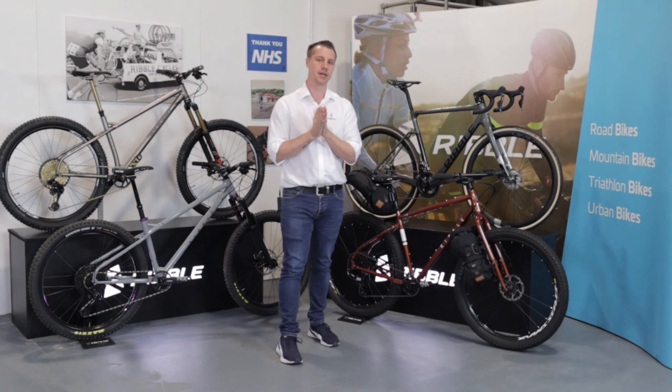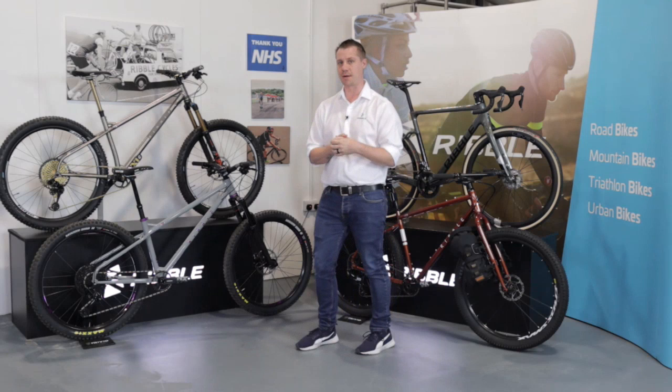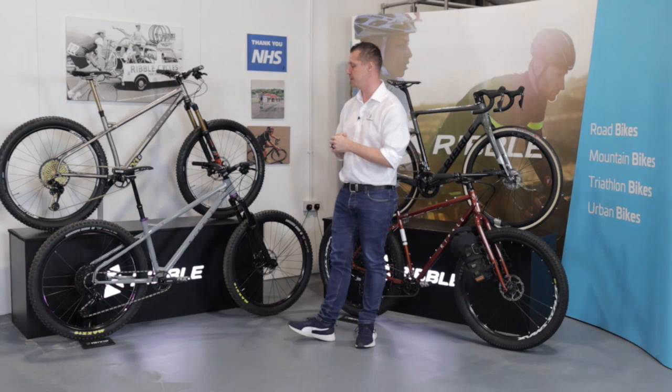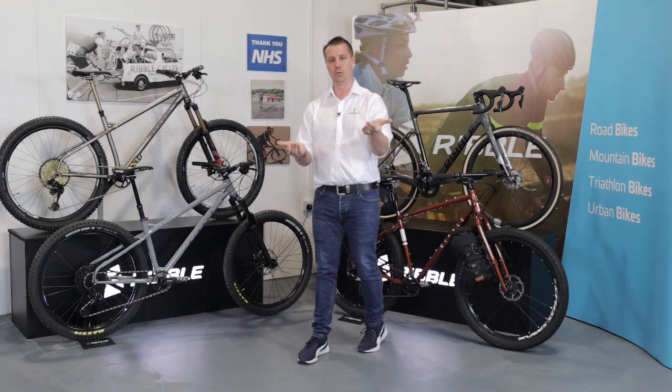And that's pretty much it for the questions now. Yes, outstanding. Nothing on the mountain bikes any further. We could cover them a little bit more. You will see through the bike building process that we have tire selection choices there, up to a 2.6 inch tire in that 650B wheel build as well. We had a question earlier on our previous broadcast, can I fit 160 mil travel to the bike? You will mess up the geometry a little bit, but yes, you are capable of fitting that.